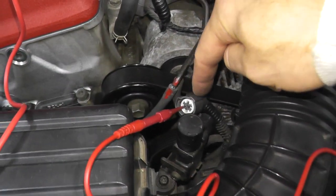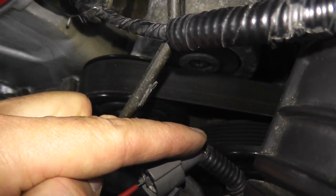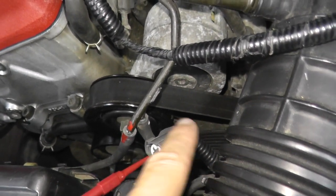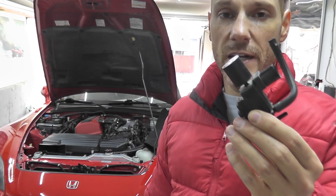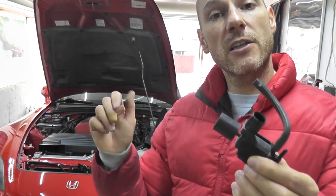Now if you're not receiving power at either prong, then you have a wiring issue. Chances are you have a break right at the rear of the harness connector — over time, if someone has pulled on this location hard enough, it will dislodge the connection, so just check right back there. And that's how you tackle this trouble code. Chances are it's the solenoid valve itself that needs to be replaced, but always check these other things first, otherwise you're just throwing money out the window. See what's going on, get your car back up and running, and as always, thank you for watching.